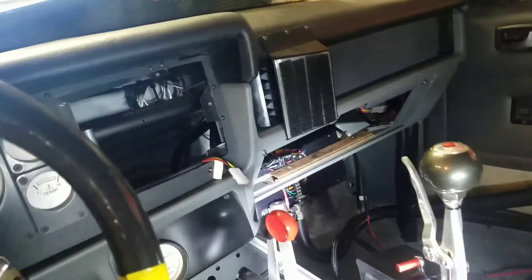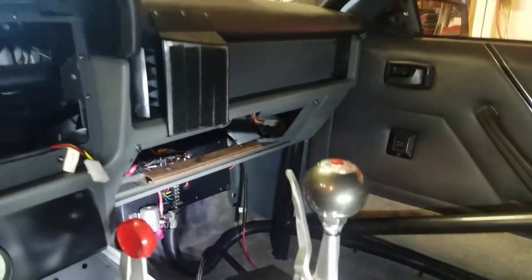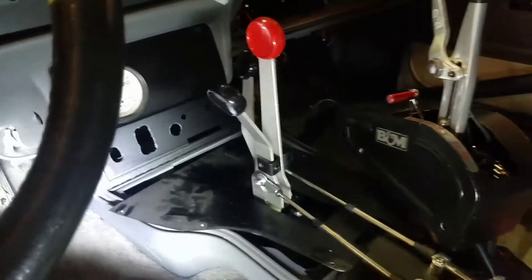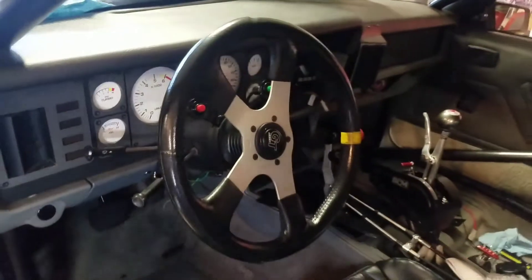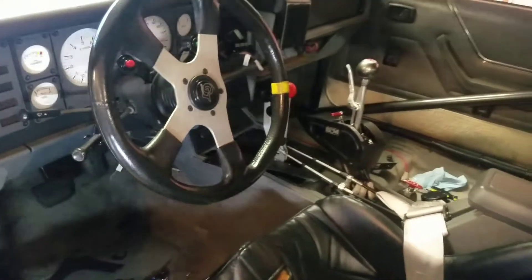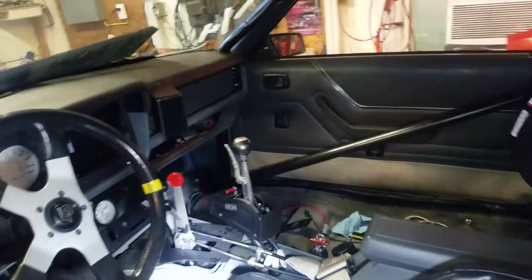Let's check out the interior. That big hole in the dash is where the tach used to be — I got rid of all my mechanical gauges, and it's all going to go through the ECU now. All that stuff mounted at the bottom is gone and I've got a lot of rewiring to do. I am going to keep the mechanical water temperature gauge and also put a mechanical oil pressure gauge out by the engine bay, just so when I fire the car up cold I can verify oil pressure. I might put a small fuel pressure one out there too, just because I still like mechanical gauges as a backup.